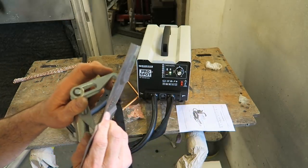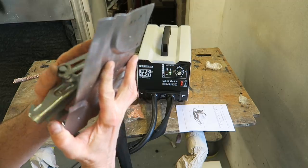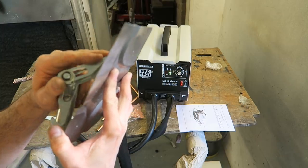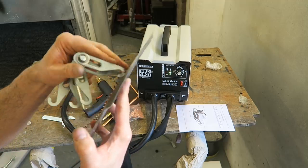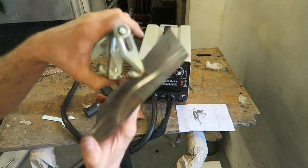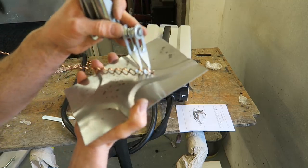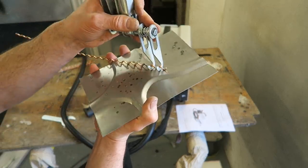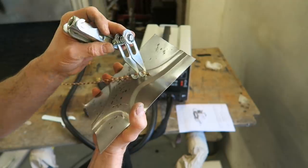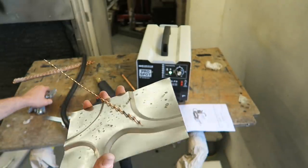You can wrap these hooks around the wire — I think the wire is slightly too shallow for the hooks, but it just needs a bit of a fettle with a belt sander. You can see that if that were welded to a panel and you got a slide hammer on there or the line puller I intend to make, you could give it a tug — it is really, really welded on there well. It's only taking seconds to weld the wire on, and then you could give it a good pull — another nice accessory to the kit.